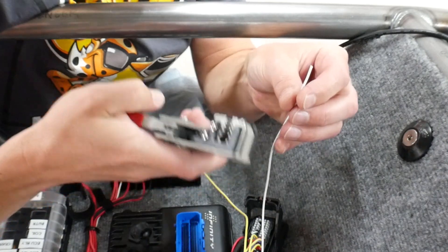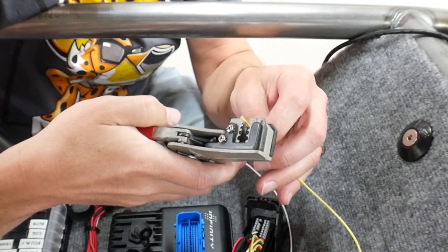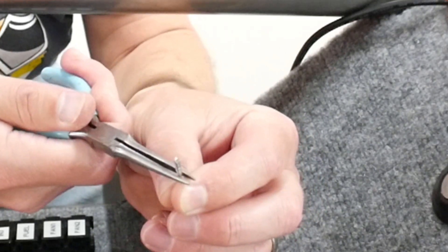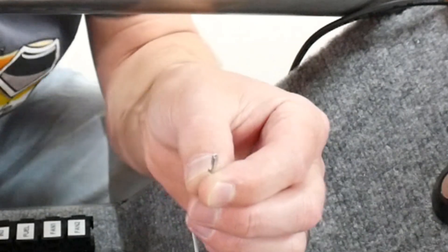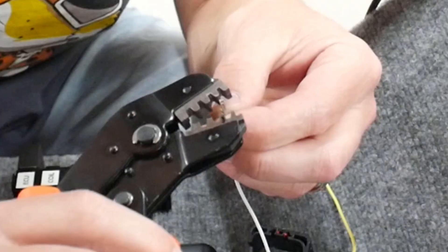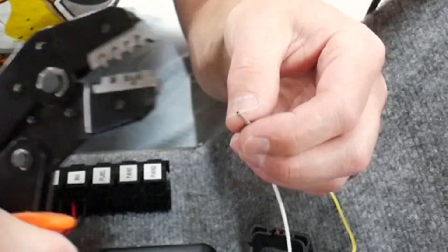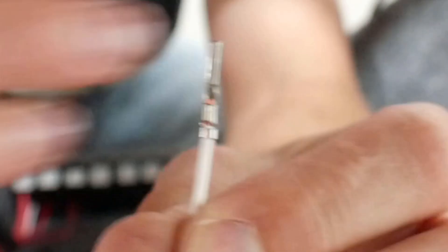This is 20-gauge actual automotive wire and I'm going to trim back just a little bit with my automatic strippers. I've got the terminals here — I'll put a link in the description for these terminals. You've seen me use these before when I was working on the GM ECU for Mauler; it's actually the same terminals. I always crease them in a little bit — I just find it a lot easier to get started. These crimpers are one of the best tools I've ever bought. I'll put a link in the description for those too. I'm going to put it in, make sure the wire is where I want it to be, and then crimp down. The bottom part crimps onto the insulation just for strength, and then the top part actually crimps the terminal.